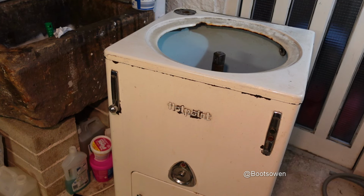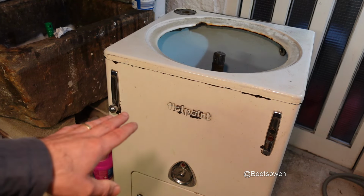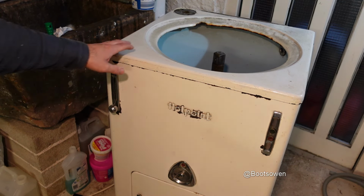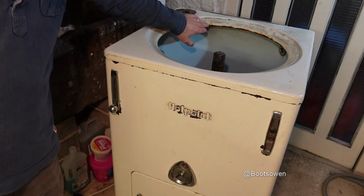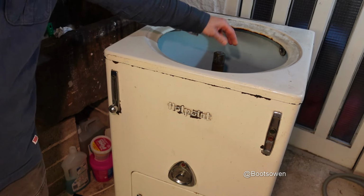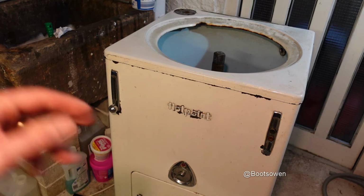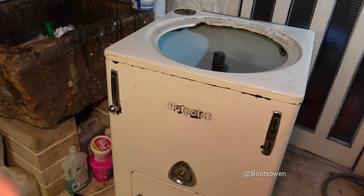It's good. It's kind of cool that it works. I think I'm at the same conclusion I was at when I bought it, that it's kind of not worth fixing. It's too rusty. You see all that rust around Hotpoint? It's been badly painted. Well, it was probably well painted, but it's all rubbed off. I'd say the top was always enamel, and that was always painted. You've got your rust around the back there. You've got corrosion in the pipes. You've got almost a 1/4 inch of slop in that agitator. It's an artifact of the past, but it's not something I would use every day. I don't know what to do about the heater. It is what it is. I'll probably just leave it and put a note on it, or this video will be that note. And all those crumbs inside, really that gearbox is probably well worn out. If this was somebody's main machine for the best part of 30 or 40 years, there you go. Could have been used up until 2000, they didn't have an automatic washing machine in the house.